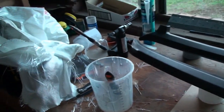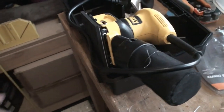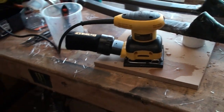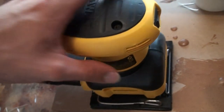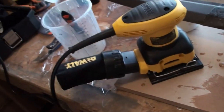So today, as I almost always do when I do a build, I go and buy a new tool — I did it again today. I went and bought a little palm sander — this is a DeWalt. I have got a sander already, a third-sheet-sized one. This is a quarter sheet, but I can take the whole black vacuum dust bag thing off if I need to get in tight spaces. These things are really good. You just get a roll of sandpaper, roll it out, cut it, and lock it into the metal tabs so you can put any grit in. And if you want to get the holes in for the vacuum, it even has a thing you stamp it in, and it punches those holes for you. Cool, we've got a little DeWalt there, we'll see how that goes.